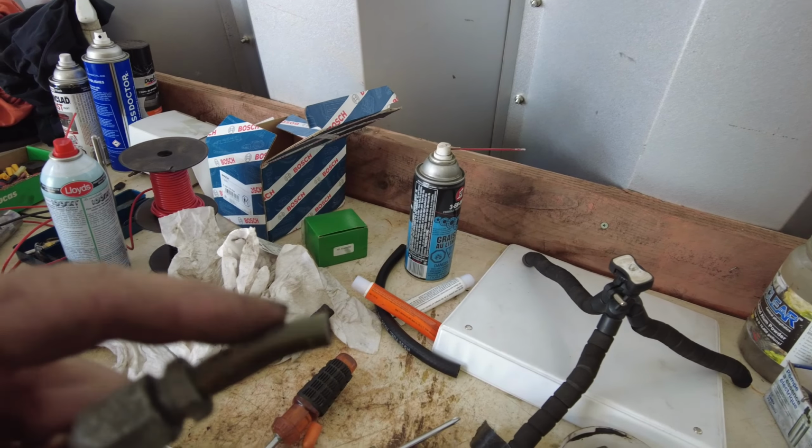This long rubber hose was going from the fuel pump to that connection there, and I don't think it's real pressure hose. It's 3/8 hose, but I don't think it's made for fuel injection pressure. It's fine for just a joiner, but it's not for the whole length. It wouldn't hold the pressure very long before it gave out, and then you'd be unhappy. So now I'll just keep on putting it together.